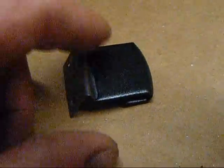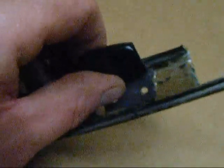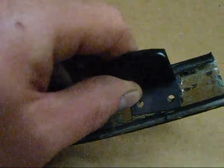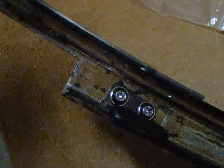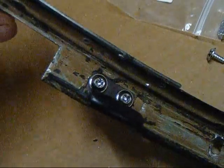We're now ready to install our new replacement unit. These are really nice — we've got a rubber coating on them and it's very simple. All you're going to do is lay the unit back into place. It fits in just like the GM did, and then you can either pop rivet it or you can use very small screws and just screw it right in. We've installed two screws, and as most guys don't have a rivet gun at home, two screws are going to work real well.